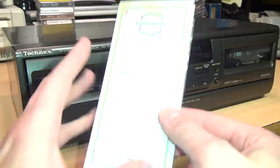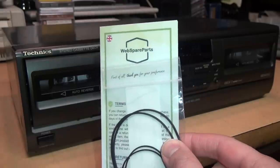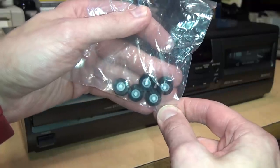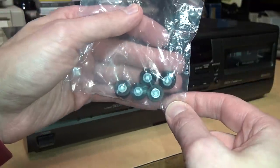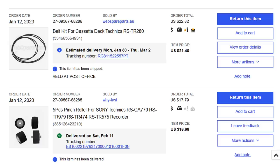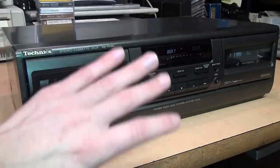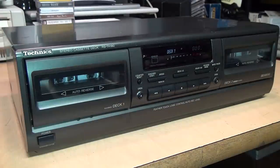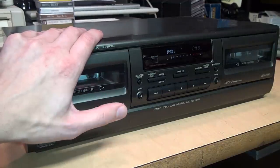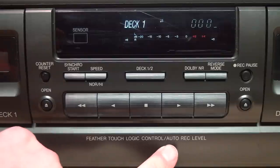Some of the higher end Technics decks you can buy replacement gears for, but this one you can't, so if those gears are cracked it's game over. I was able to get a belt kit — a set of four belts from Web Spare Parts for $22.82 — and a set of pinch rollers for $17.79, coming in a set of five even though it only needs four. My total repair cost so far is right around $40 for a deck that's worth about $40 in working condition, which is why I declared it not worth repairing — especially since this is a very low-end deck lacking features like manual recording level control.